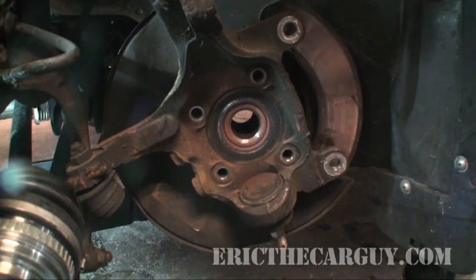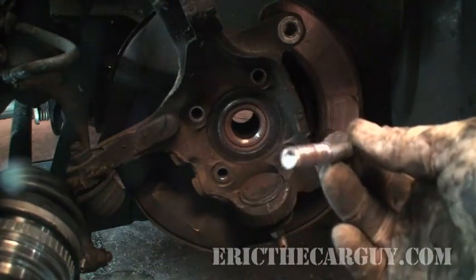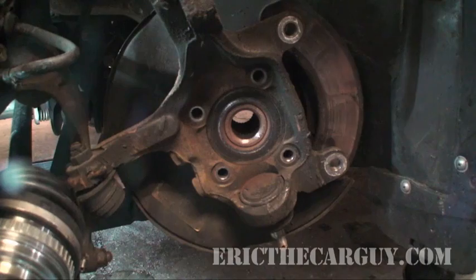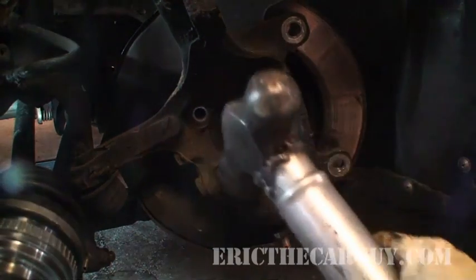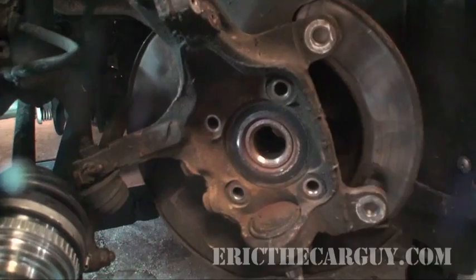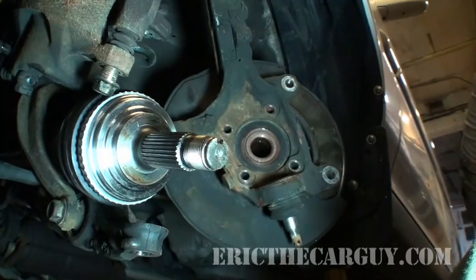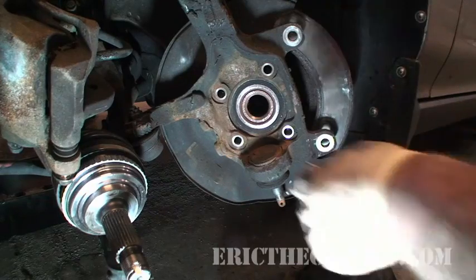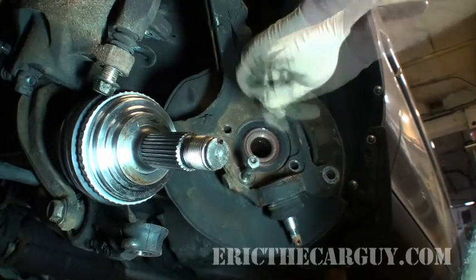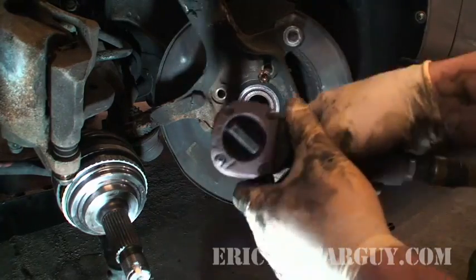Just like in the last video, you take those out — these bolts look like 10mm bolts to me, so I'm going to say they're probably 10x1.25. But before I insert the bolts, just like in the last video, I'm going to hit around the outside to try to knock the bearing loose from the inside of the knuckle here. Remember: hit what it goes through. Now that I've done that, I'm going to install my bolts — the straightest ones I've got. I really just need two, and I like to tighten these down so more of the impact goes into the bearing when you do.